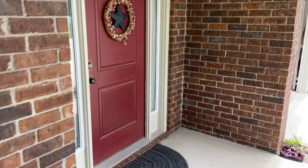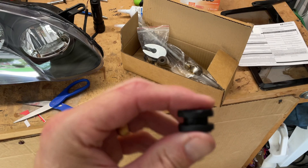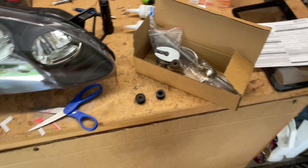Here are the bushings. Normal stock bushings are soft and mushy — that's intentional from the factory. This is a base bushing: when you shift it hits gear and has something to soften the impact. Here's the cable bushing — same idea, it has softness built in. You put a firm bushing in there and it eliminates that cushion. Before, you'd put it in gear and it had somewhere to land and bounce — now it doesn't.